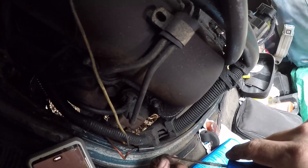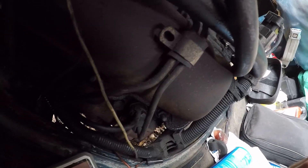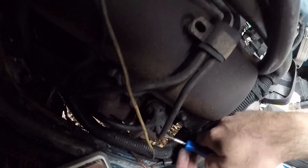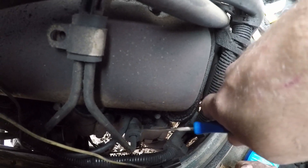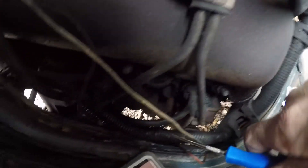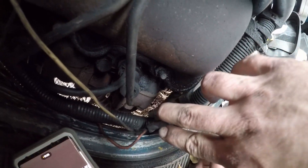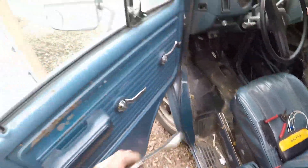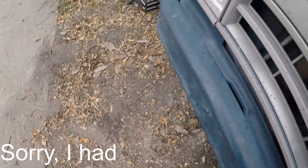To change these out easily, you can access from up here, but I highly suggest that you do the whole driver's side glow plugs from the bottom. You'll have one here, and then all of the others are underneath the fuel rail for each corresponding cylinder. From the bottom, you'll be able to see they're all red wires with a black connector. The other tool you'll really want is a 10 millimeter socket with a quarter inch ratchet.